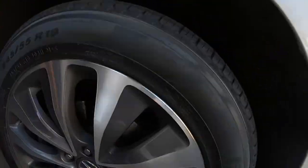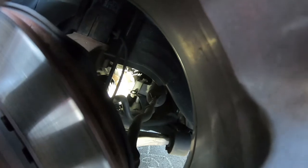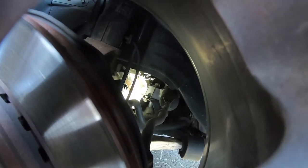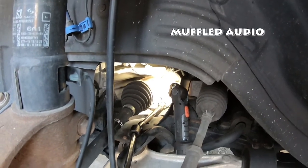Got sight of the fill bolt. Look at the fill hole — can you see it all the way in the back there where the light is? That's where I've got to get. It's just on the other side of the bend of that sway bar. Doesn't look like the camera's picking it up, but it's another 8mm and I've got to figure out a way to get in there. We'll be right back.